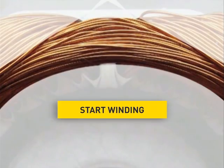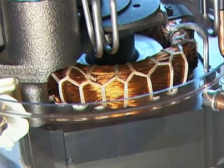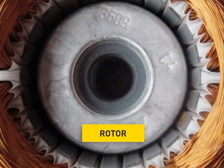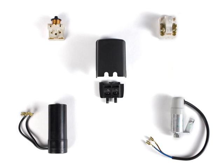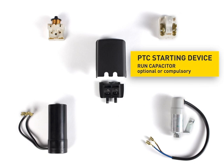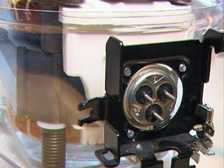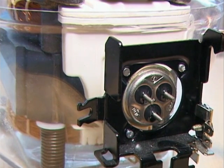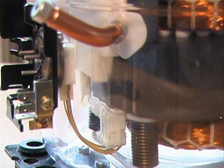A start and a main winding. The windings are protected against the loosening of individual wires to avoid damage. The rotor is an iron core cast in aluminium. A suitable starting unit is installed depending on the compressor type and later application. Here, a PTC starting unit is shown on the right and a starting relay on the left. The starting unit is mounted on the current lead-in of the compressor shell. It's the starting unit's task to supply the start winding with power for a short moment in order to enable the starting of the compressor. As soon as this has happened, the motor operates only through the main winding. The power cable ensures a flexible connection to the motor.